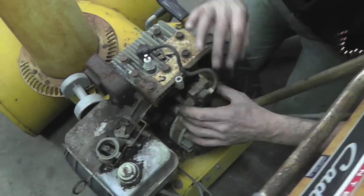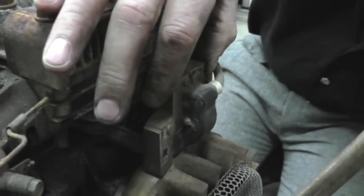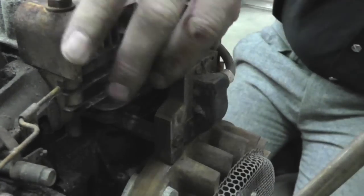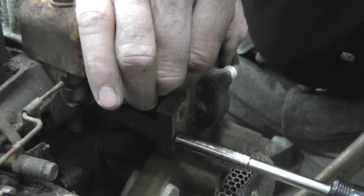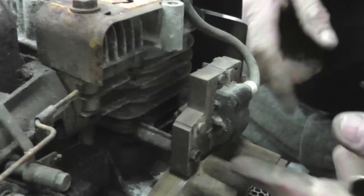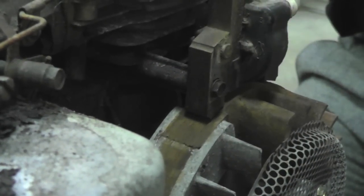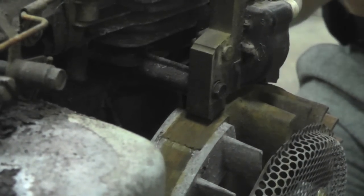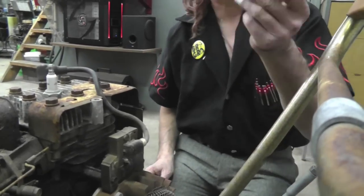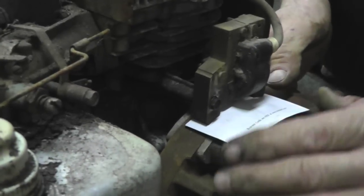Then all you do is take your old screws, bolt the coil on, pull up on it, and snug it. Then you want to create the air gap that goes between the magnets — here's the magnets, see? It's sticking to it. So you get a 0.010 feeler gauge. If you don't have a 0.010 feeler gauge, you can use a business card. Line up the magnets with the coil and put the business card in there.